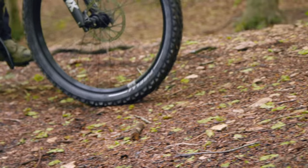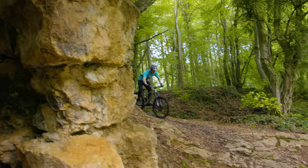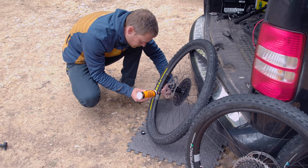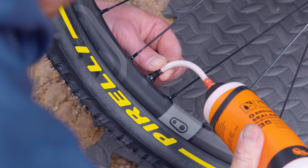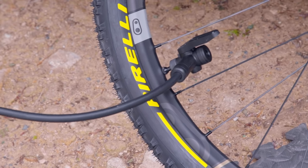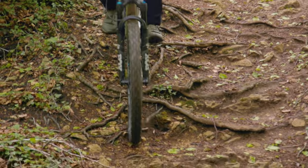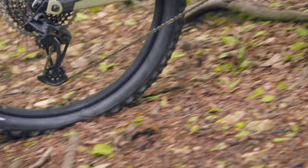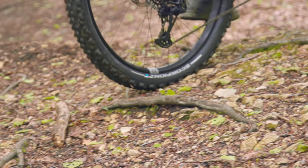Hopefully that's given you a taste of things to come. There's a lot of detail, but they are all things to consider and illustrate why tyre pressure is a continuous process of trial and error to find the right pressure for your setup, terrain and conditions. In a minute I'm going to delve into some numbers. Just before then, two quick caveats: first, I'm assuming your mountain bike is set up tubeless — meaning the inner tube has been removed, the rim sealed with a rim strip or UST, a tubeless valve and sealant added. Tubeless setups puncture less and give better ride qualities. You can also run tubeless tyres at slightly lower pressures, as you reduce the risk of pinch flats where an inner tube gets pinched against the rim and punctures.